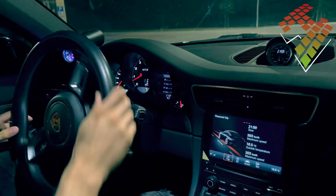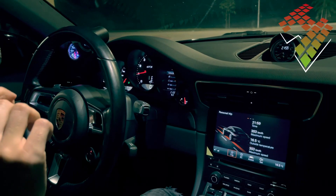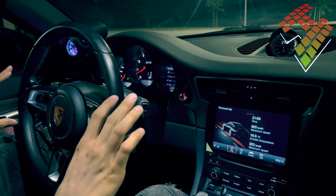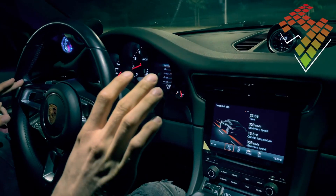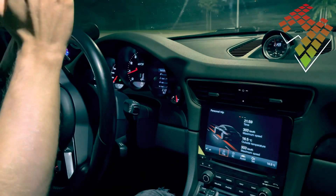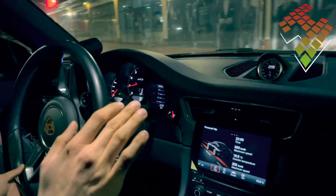The take-up is very precise. It uses adaptation values — it analyzes the clutch bite points and so on. So it is possible to move very, very slowly. No shake, no pulsation on the take-up, no judder whatsoever. Very smooth. You can do very precise movements — stop, start to roll, stop. Very little throttle without RPMs bumping high. Just cancellation of the lash. Very smooth.